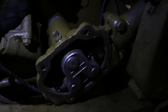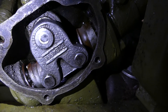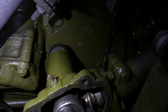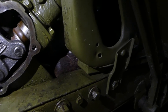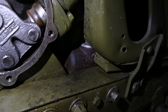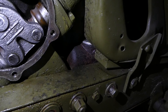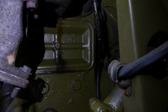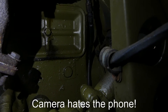So there you are, that's all painted and looking a lot better. I'm using the phone light to see inside — the worm gear looks in pretty good condition. Before we put the cover back on, you can see the master cylinder down there is getting a bit corroded, so I'm probably going to slap some anti-rust treatment on that and then paint that as well before the wing goes back on. We're also going to have the valve cover off because I've not got the best gasket seal going anymore, and I have a gasket for it, so we'll do that whilst the wing is off as well.